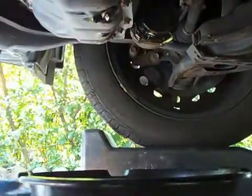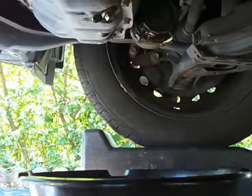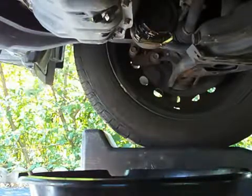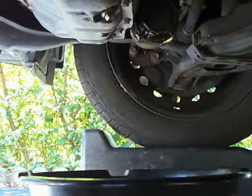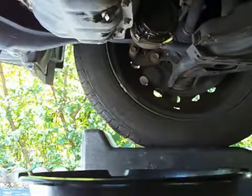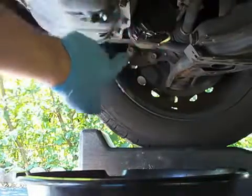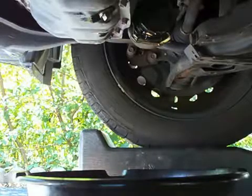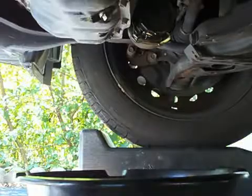There we go. The car needs 4.4 quarts of oil, but don't go ahead and pour 4.4 quarts into the crankcase because you're going to overfill it. Put in 3.5 to 3 3/4, and then check the level and keep adding a little bit until the level is right. And then after that, wipe all of this down with paper towel, and then start the car and check for leaks, and make sure that it's not leaking here or here. And if there's no leaks, then you're good to go for another 5,000 miles.